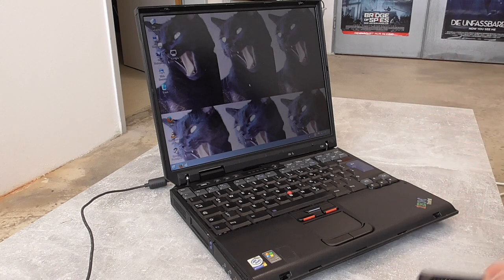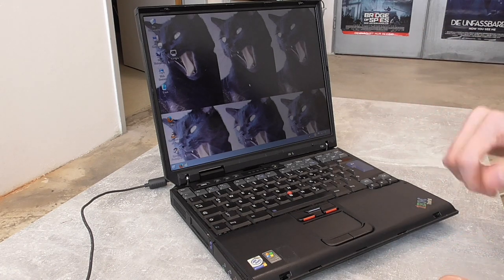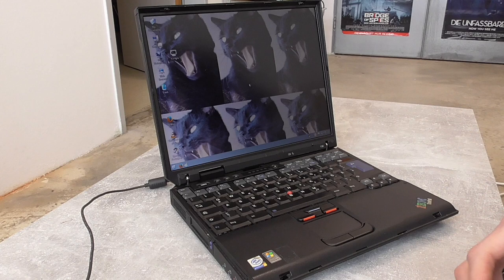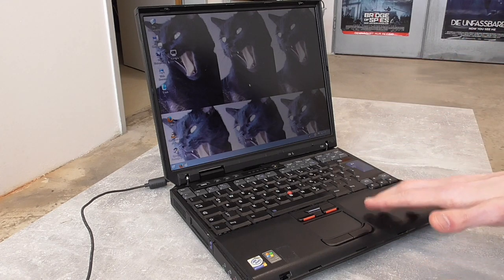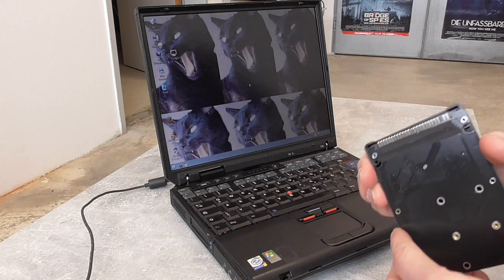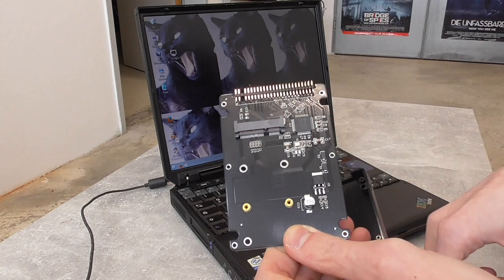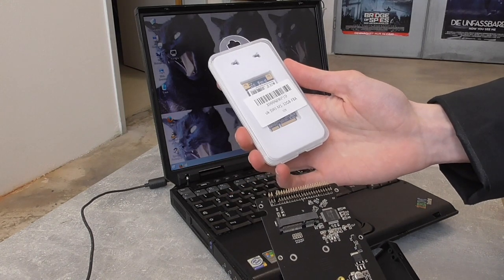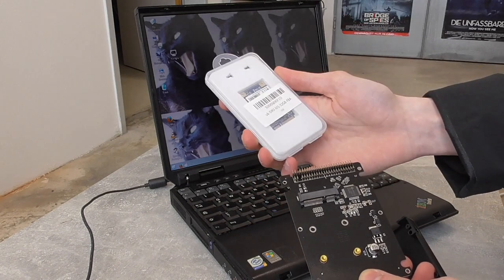It's gonna wear out, the access rates are slow - you're right, it's not ideal. You can run Windows 9x pretty good on compact flash or SD cards but newer operating systems, not ideal. This was only a test run and I like Q4 OS, so I decided we're going to upgrade with a mSATA to IDE adapter and a mSATA SSD I've had laying around in my drawer for years.